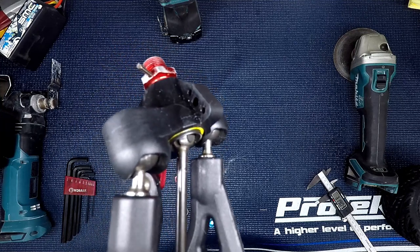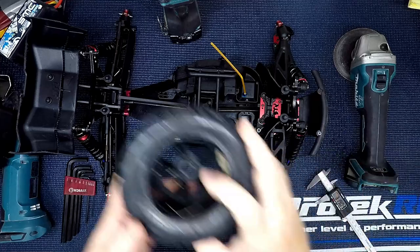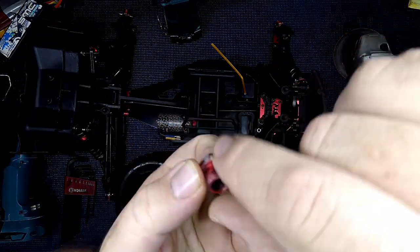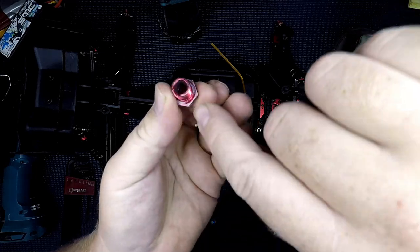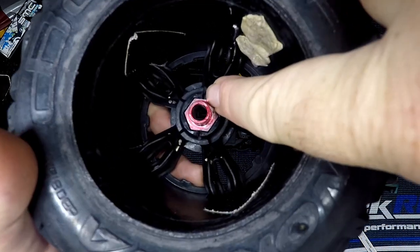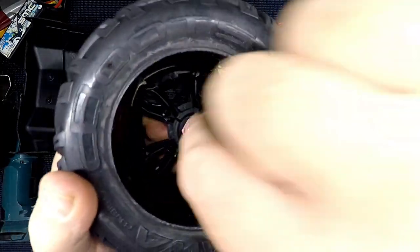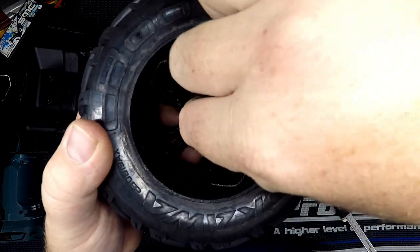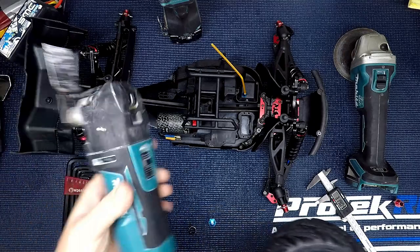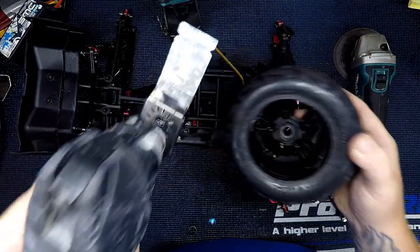This will lock into the wheel and it won't allow it to turn. I recommend doing this before you strip your wheels — definitely some preventative action to be had. For notching the wheel, you want to take a Sharpie and mark where you can see it on top, where the center of the hole is on both sides. Then drop it down inside the wheel and you should be able to see your Sharpie mark showing where to notch the wheel. The only tool I found for notching that made any sense is an oscillating multi-tool with a cutting bit.